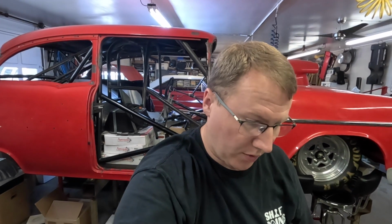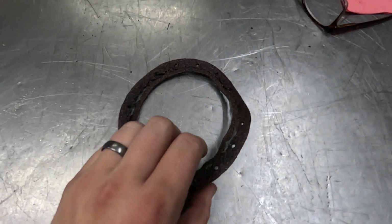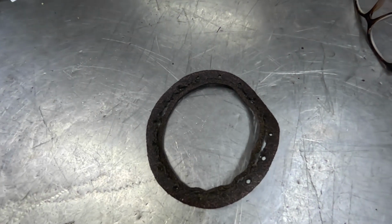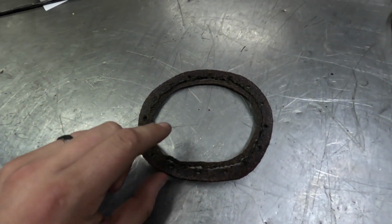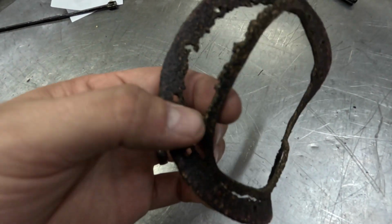Quick side note, this morning off camera we realized that the past couple times Dad's filled the red truck up and we've taken it out, it was still leaking gas even after all the things we did, tightening up all those bolts and plugging that hole and everything. So we dropped the tank on it this morning and this is what we found. This is the gasket that goes around where the fuel pump goes through the tank, and this thing is shredded. Two pieces. We didn't put any sort of aviation cement or anything on it either. Like we normally do for something like that, we'll put it on both sides of the gasket and then bolt the whole thing in, seal it up really good, which we did on the sending unit one, but we did not do on this one. But luckily we found this because, like I said, it's in two pieces. It's just deteriorated and broken up.